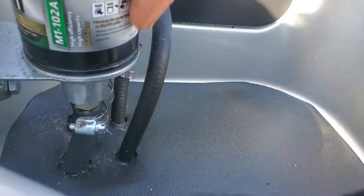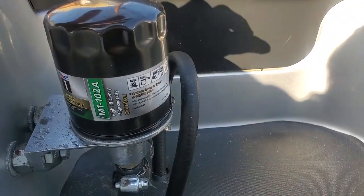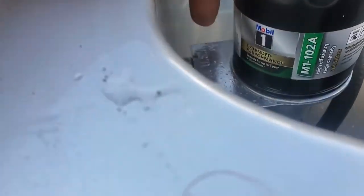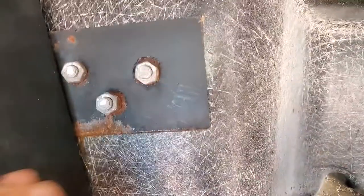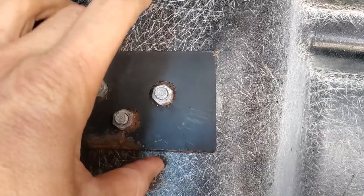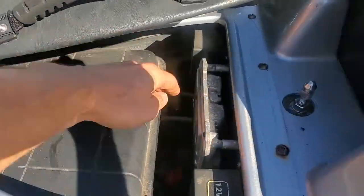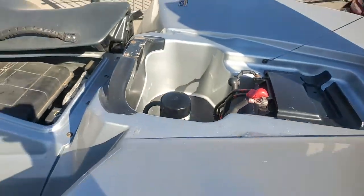The only drawback is you have to make sure that these hoses are put in properly. If you put them in backwards the oil will not flow through the filter, so you have to do it exactly as shown — these come with instructions on where the inlet and outlet should go. To mount it, I've used some big nuts and washers to space it out, and I did cut a steel plate to help reinforce it so that when you're twisting that thing off you're not twisting it directly on the plexiglass. With this setup, literally one person comes up, takes the front cover off, siphons the oil, reaches down, takes the seat off, siphons oil there, and changes the filter — put some towels under it and it takes like five minutes, one person.